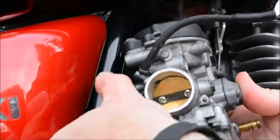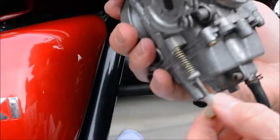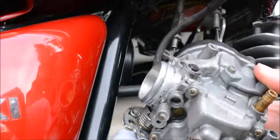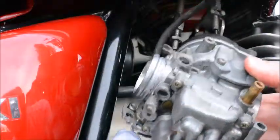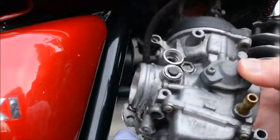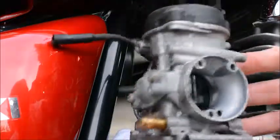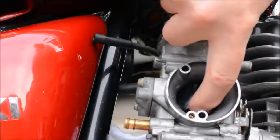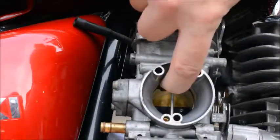With the carburetor out, we can see here's the butterfly, and here's the idle speed adjustment screw. And I'm going to rebuild the carburetor and just take off the bottom plate here, the 4 screws. Again, Japanese industrial standard, important in this case because it could damage the screws using a regular Phillips. And inside there'll be a few jets that can be replaced or cleaned. In my case, I'm hoping they can be cleaned. And on the back side of the butterfly is the tower for the carburetor. You can see it actuating up in there, and it's moving freely, so that's okay.